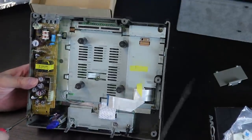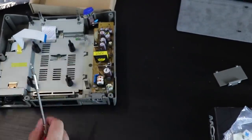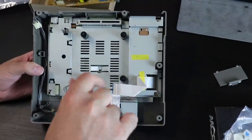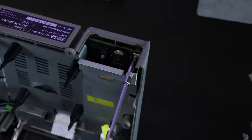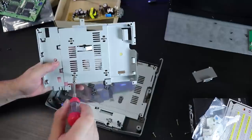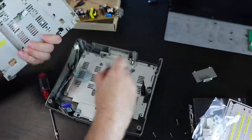We have a bunch of screws to remove. First up, the power supply unit — there's one screw on the front and then two on the back outside of the case. Set these screws aside as they are unique to the power supply unit and you don't want to use something else by accident. There's a clip on the left — if you can't get the power supply unit out, just press on it. We're getting this all out because we have to remove the metal plate and those black plastic posts, as they will be in the way of the MODE. You also have to unattach the ribbon cable from the controller port up front. This is a prime time to clean things up — make sure there are no dust bunnies in there.